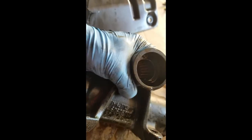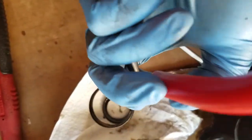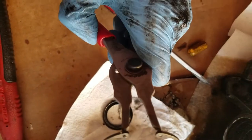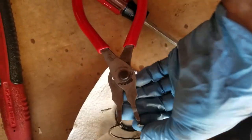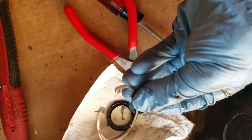That thing is cooked. Then there's a snap ring in here — which there is. And then there's the other seal. I gotta get my snap ring pliers. The flat slide is facing the seal. That's exactly how it came out — flat slide on one side, round side on the other.